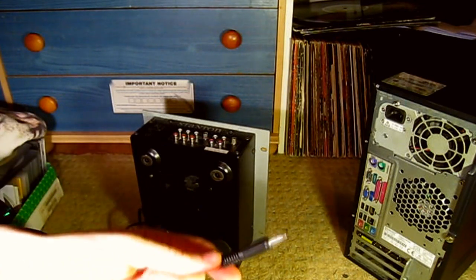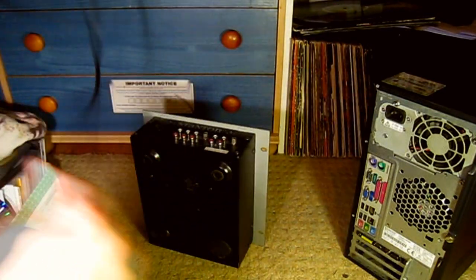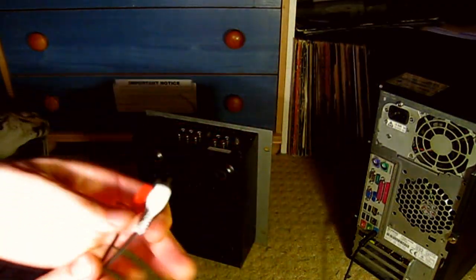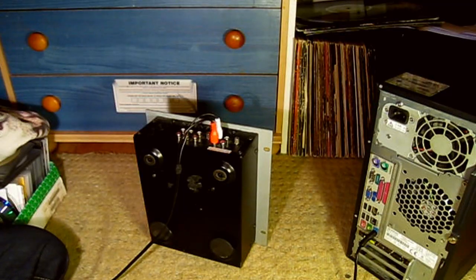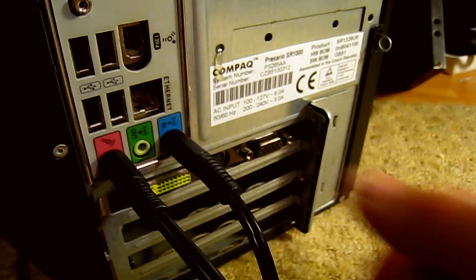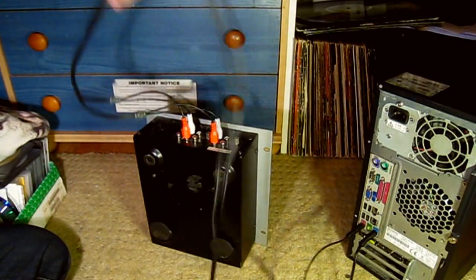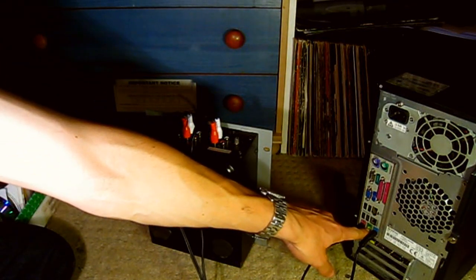To connect this up you're going to want two cables — two of your ones that go from 3.5mm stereo jacks to RCAs on the other end. Take one of those cables and connect the jack end to the rear output on the sound card, which is the blue one. Then take the RCA end of that and connect it to line one on the mixer — white to white and red to red. Once you've done that, take your other cable with the 3.5mm jack and connect it to the pink one, which is the centre and sub output, and take the RCA end and connect it to line two on the mixer — white to white, red to red. The reason to use the rear and centre/sub outputs is that it leaves your main front output for your normal speakers.